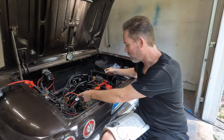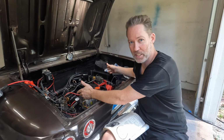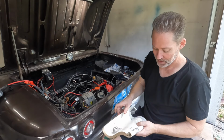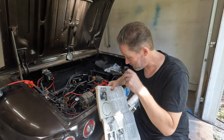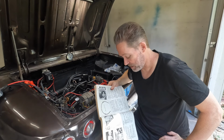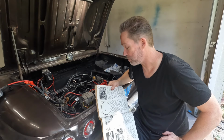However, I've got a choke issue for sure, because these two are not going at the same time. They're doing different things. Second issue: the book isn't even calling for choke at this point. It's just calling to have the choke disconnected, and it's expecting it to run. It literally says, seat the idle mixture screws lightly in their seat and back out 1.5 turns. Now, when I put it in there, these were not 1.5 turns out. There were definitely some discrepancies, they were definitely different lengths. I know right now that they're pulled out 1.5 turns, but that doesn't seem to be enough to keep it running without the choke.